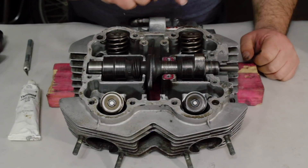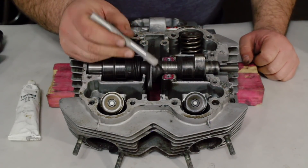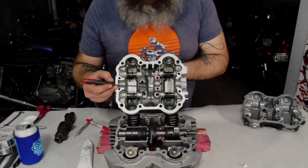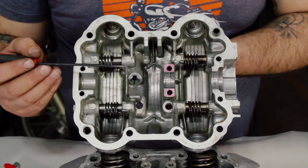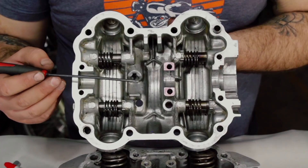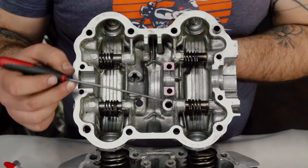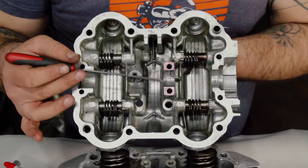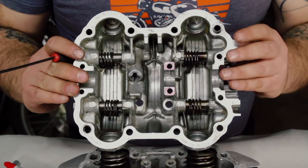That's exactly what happened on this engine. That indentation there is the indentation that came off the valve cover. The journal on that side is also chewed up — it does have a groove in it that's supposed to help with the oil, but it's been kind of melted. These are the surfaces we've got to put a shim on in order to keep the cam from getting pinched. So let's show you how to fix the problem.